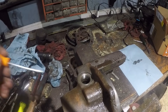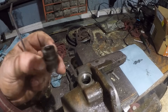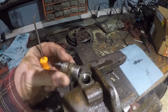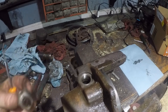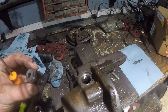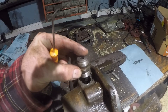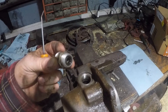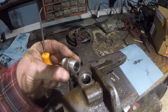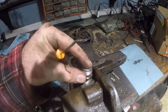There was definitely no gasket on there, and there is definitely no gasket on here either. It's a straight thread and there is no pipe dope or anything on it. I would assume that while this was driving it was throwing fluid up into here. So we're gonna try to go back on there with something — probably some kind of copper or nylon washer.